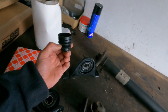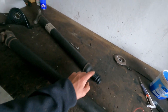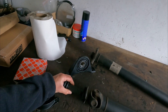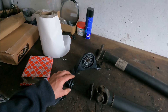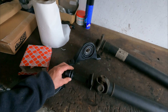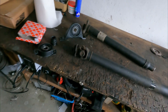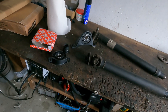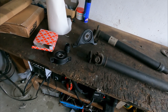I got another new seal that will go on here, to mount it with a clamp, and then it will slide over here. It will keep the shaft dry — so you don't have any moisture in between, which keeps it from rusting and that sort of stuff. So what I'm going to do: get this one off, put a new bearing on, cut the old piece out of the tunnel, and replace it. That's the first part.